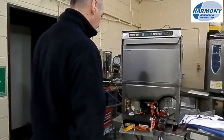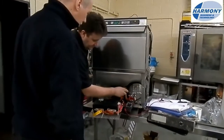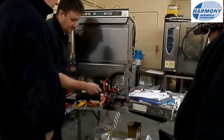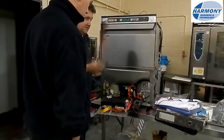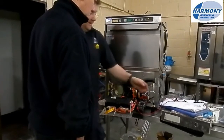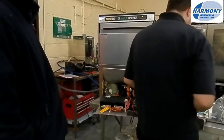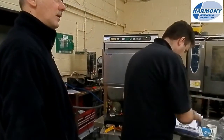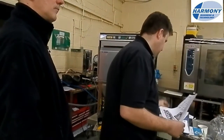Now, if you run two elements on, it will blow the 13 amp fuse, because we're running 6, 12, and the rinse pump — it will do it. But there is a way of running the elements in series. You run two elements in series and it will run on the 13 amp plug — it'll just give it a little bit more, eats it up better because it's on two elements. But you've got to put them in series with each other.